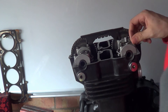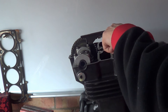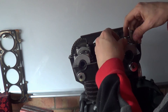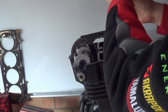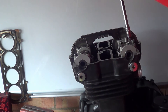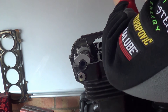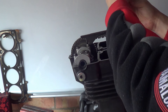Why did that just pull that thread clean out? Literally 12 Newton meters - it wasn't tight. It's just stripped the thread clean out of it. I was just looking to see if any of the rest were in bad nick too. These are all being done to 12 Newton meters - there's no denying that. This torque wrench isn't wrong because that is nothing. That's what 12 Newton meters feels like - nothing. I'm not wrenching on it. I've just got to take the whole bloody thing off.